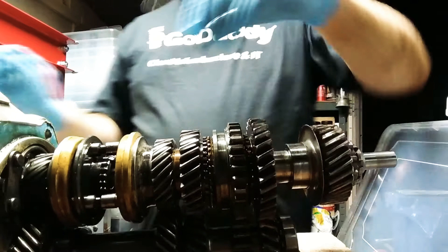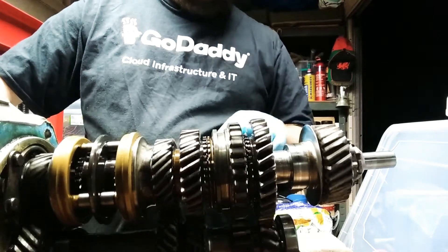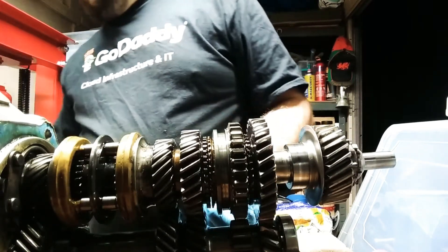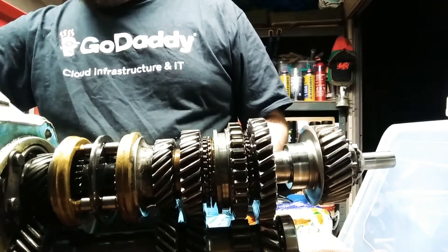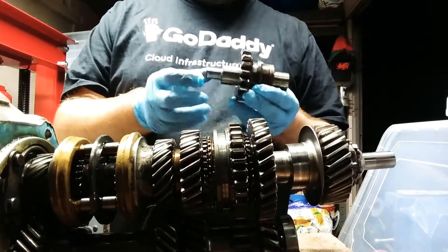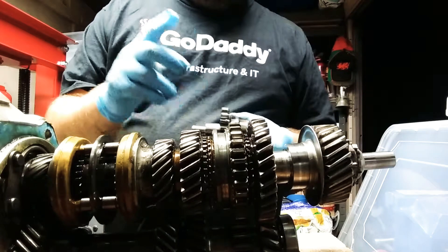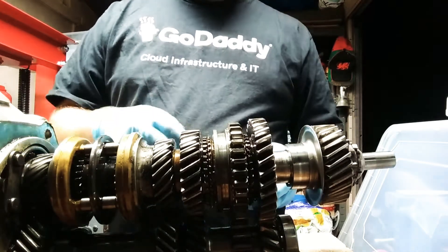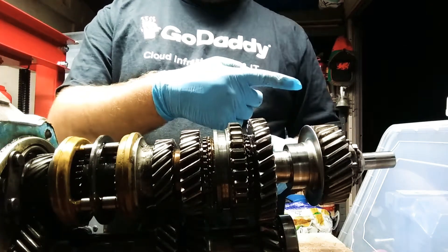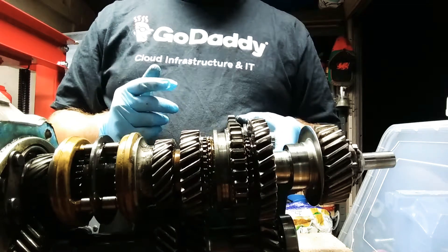So I put it back in neutral. Reverse is here, on the straight-cut gears, and there's a straight cut on the layshaft as well. And then there's the reverse, which I've got here — it's a bit hard to show. So it goes around this way, and it slides on here, and that's where the little selector arm goes. When it engages it, it locks it in between this one and the one below, and then when you turn it this way, because of this, this one turns the other way — so you get reverse. And also because it's straight cut, that's why you get the whining sound when you reverse.